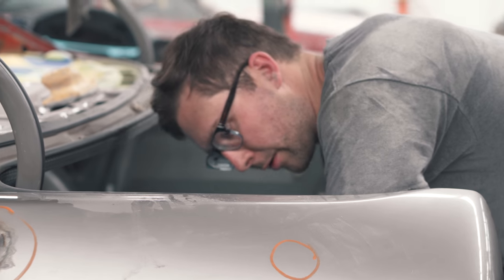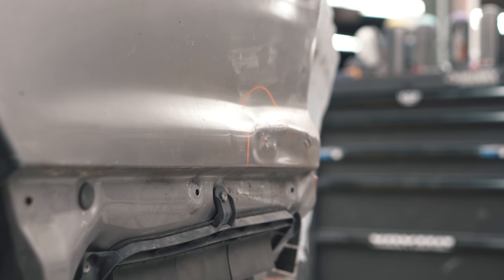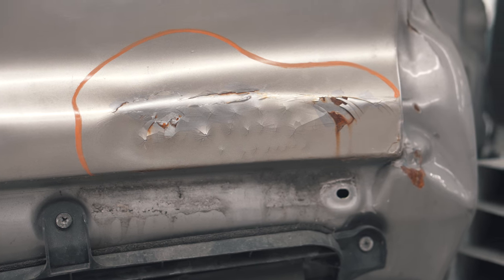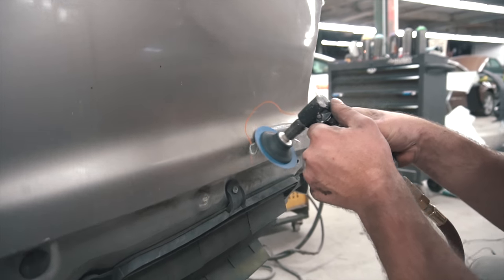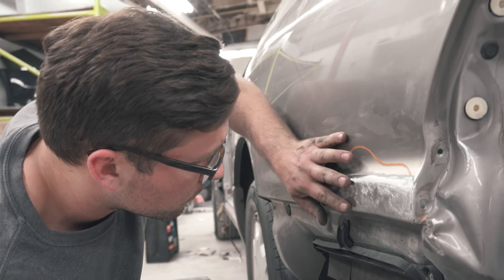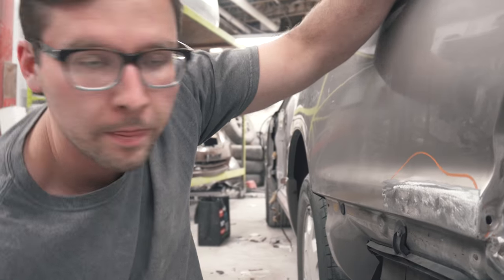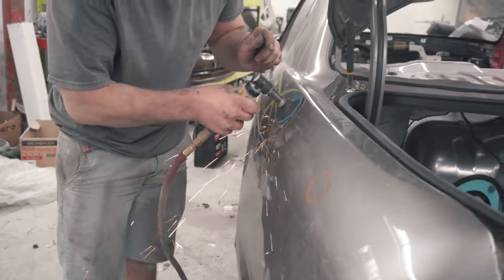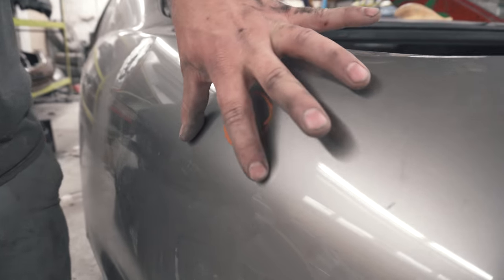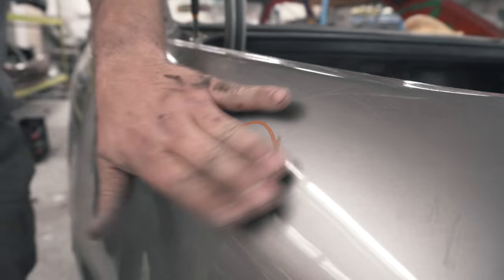While that's cooling down I'm gonna bang this out with the extension. It's a little low in there but I'm just gonna fill her up. I'm gonna grind this out. A little 120 grit sandpaper — what I like to do is sand around it evenly when I'm doing a bunch of top coat dents, so then I know where the dent is in the middle of where I'm sanding.